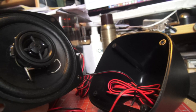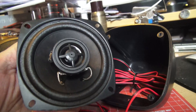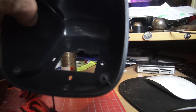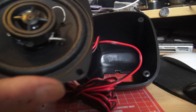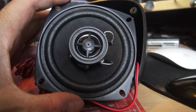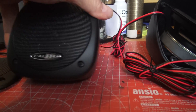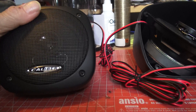Now the only thing is that the enclosure it's in, as you can see, is barely any bigger than the actual back of the speaker, which means that despite the fact that this will actually go boom in a small space, my sneaky suggestion for the clever installer is to actually maybe cut the bass out and use this as an ornament on top of a slightly bigger parcel box hidden underneath the parcel shelf. Either way, I've tried them on just a few watts with the CA75.2, which is a little 25 watt by 2 amp, and they're pretty good. The bass that comes out of them is limited because of the cubic volume they've got to work with. I think you'd get more if you sealed them down well, and if you did put proper power into them - like a good 30 solid watts - which they'll handle with ease.